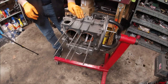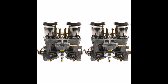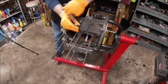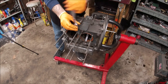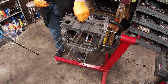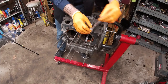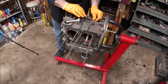I've come to a conclusion — I do have a set of 40 IDFs to run. I need to get some intake manifolds for them, the intakes, and the hex bar. I think I'm going to go through CB Performance and go ahead and get the electric fuel pump and a regulator with a gauge to clean up the engine compartment. No fuel pump visible, dual carbs, the coil hidden — it really cleans the engine compartment up very nice. That's the plan and I think it will look very nice. I don't like a lot of clutter.